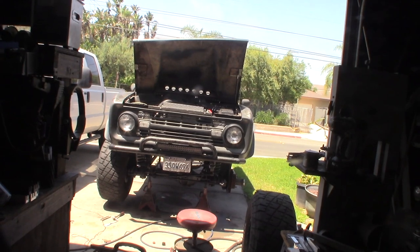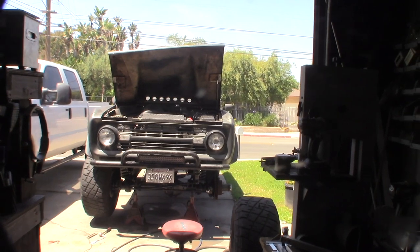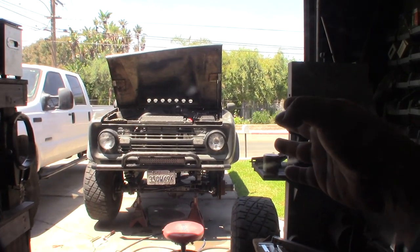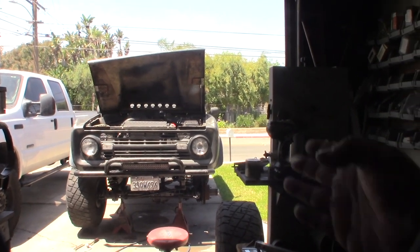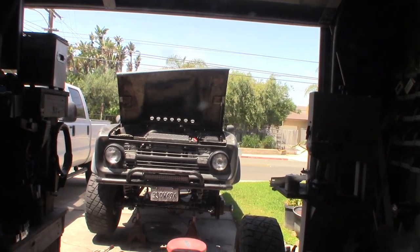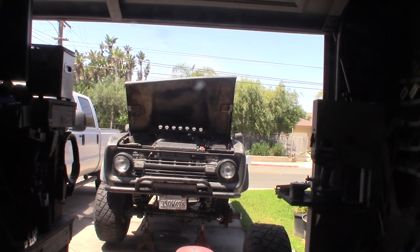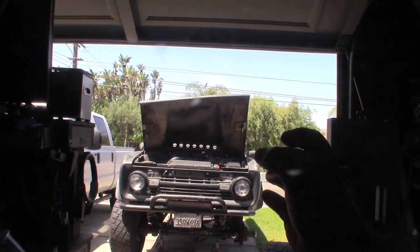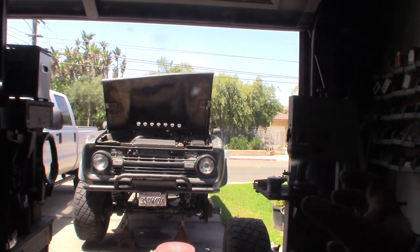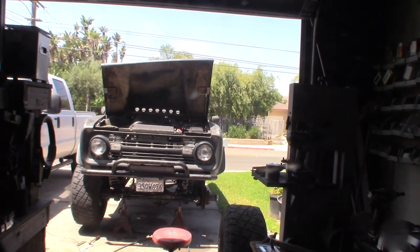What's funny is that with my steering stabilizer on there, it kind of dampened the problem. I also had a bunch of loose components like the track bar and a loose steering shaft. I've made videos about me trying to solve my play issue, my death wobble problem. But by fixing everything, it actually just amplified my death wobble, because there's no longer a shock or space to pick up the death wobble. Having a bunch of loose components was acting as a damper to the actual root cause of the problem.